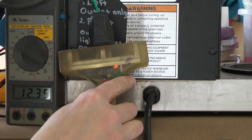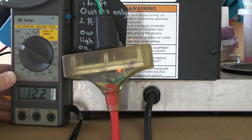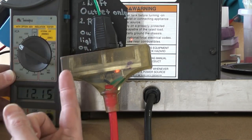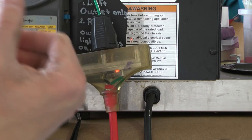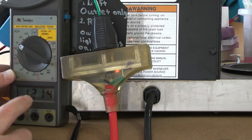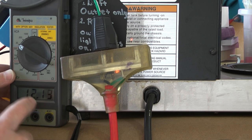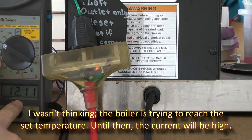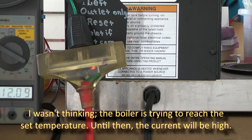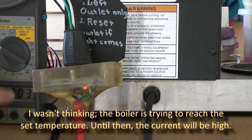12 amps straight away. 12 amps straight away is quite a lot. Or maybe it's because the temperature of the boiler hasn't reached temperature yet, so it's trying to heat up. One thing I can try to do is put a small pot in there and put some water and see if it boils. If it boils, this is quite a lot of energy being consumed almost in a standby capacity. So definitely there's something sick here — something that is not quite right.